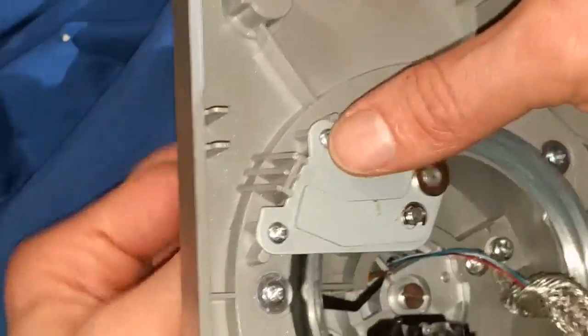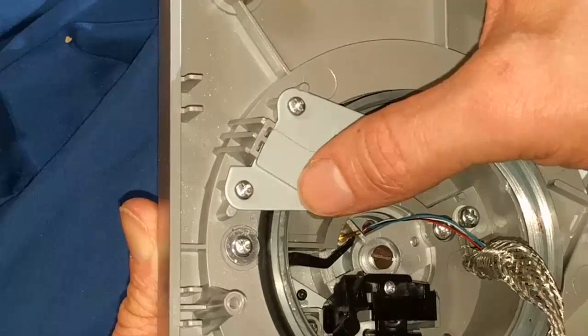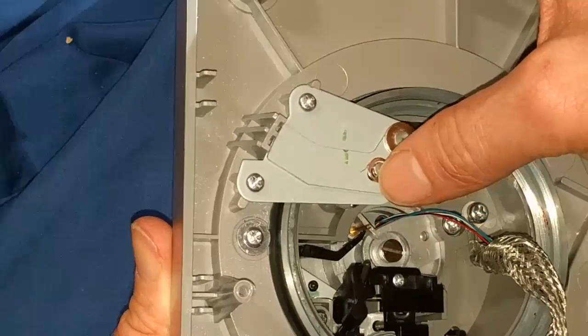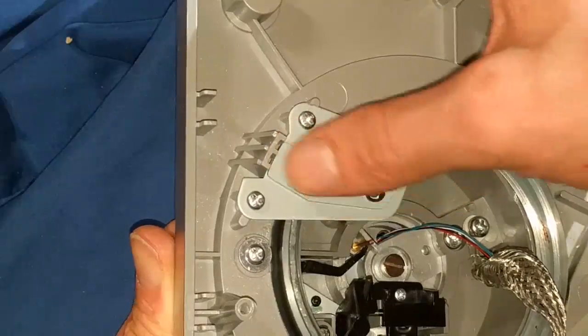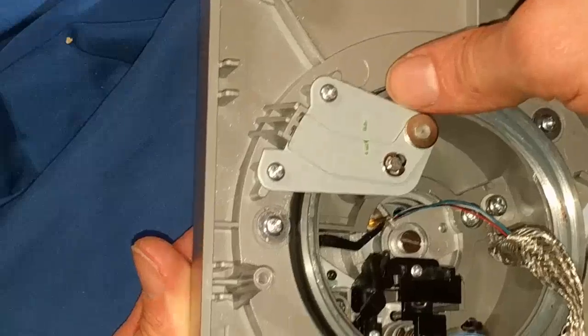When I turn the lock, it rotates this pin so that it pushes this metal plate here into the plastic. And this pin is just rotating, because it's an off-center pin. When you turn it, it rotates one direction. And so once it hits that plastic, it becomes harder to move. Kind of a weird locking mechanism, but there you go.